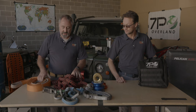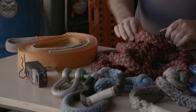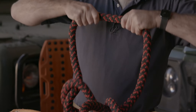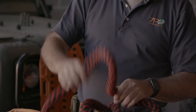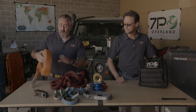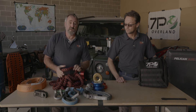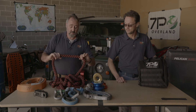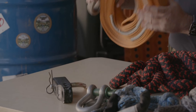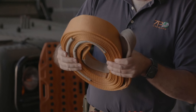The most important parts are the strap and the rope. Kinetic gear, unlike static gear, is made from stuff that stretches. The rope is woven in a particular way and is made from nylon. The strap is also made from nylon. The ropes stretch to about 30% of their original length; the straps stretch to about 20%. The straps are a little more convenient — they pack up better and take up less room, so if you've got a smaller vehicle that's an important consideration.